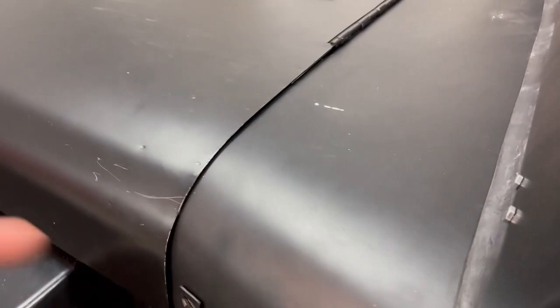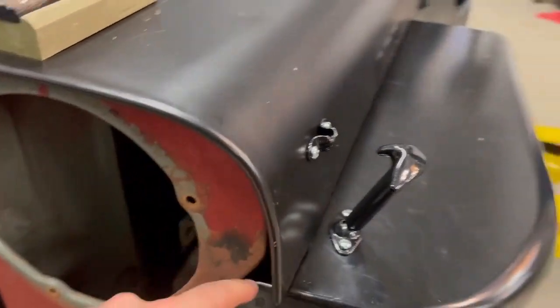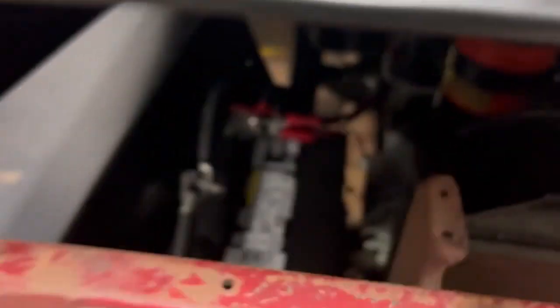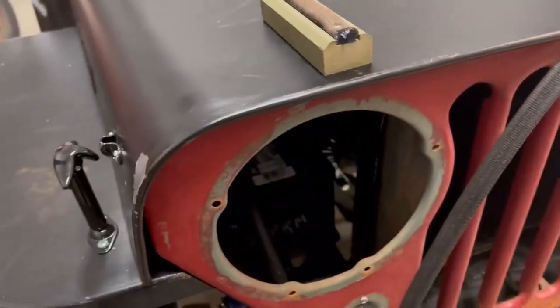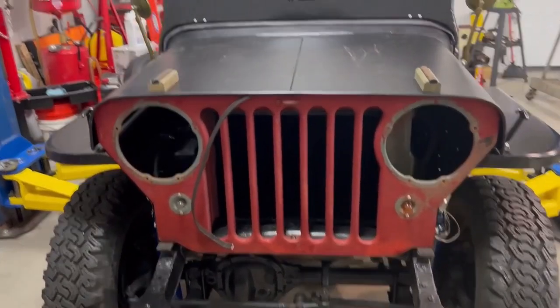I needed this area bent down so the seam line would come down closer to the fender and look better — give a better angle. Is it perfect? No — I'm not a body guy. Coming up to the front, same thing: I had to pull open the front corners a little because they were hitting the grill. I haven't stapled this in yet, but this is the reproduction weather stripping I was using to test-fit. I made a little bit more of a mess on the other side and had to bang it out a bit, but all in all, things are pretty symmetrical.